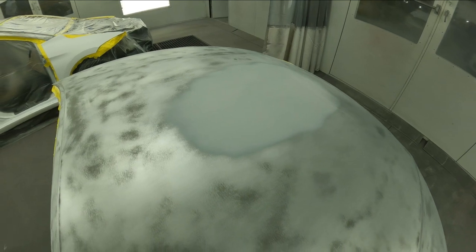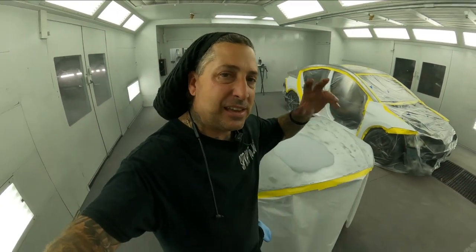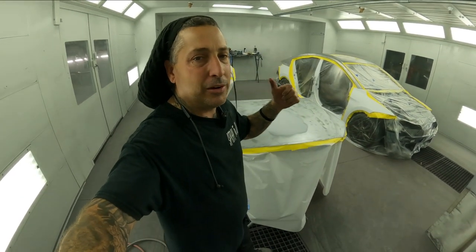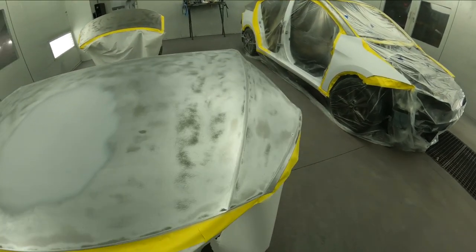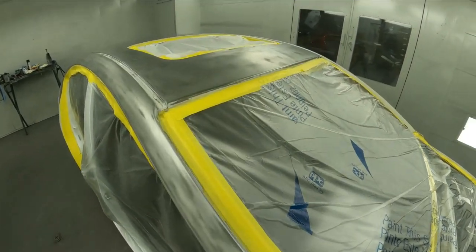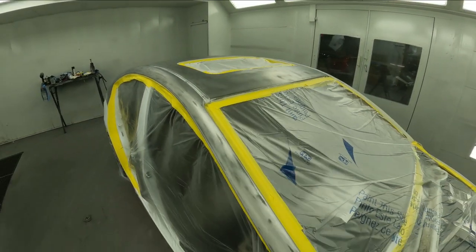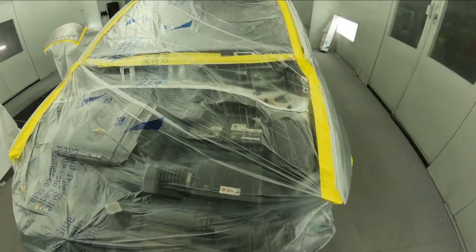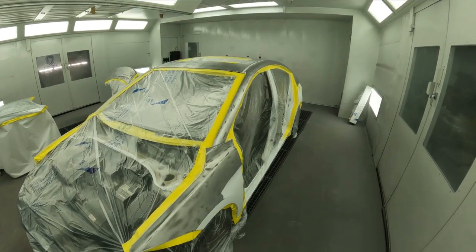But now I'm gonna show you how to save time, because if you were to have to prime this whole job and re-sand it all, it's gonna take you that much more time, and you're gonna have that much more material in it. So we're gonna show you that you use your wet-on-wet sealer, the same one we use for the restoration work, as a sealer, and then move right into your base coat and save a major, major step in the refinishing aspect of this by not having to sand it and prime it. So I wanted to show you guys this, another benefit of the epoxy primer.